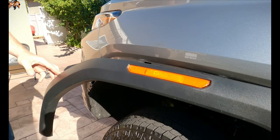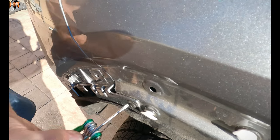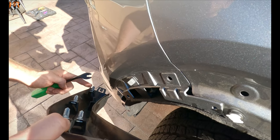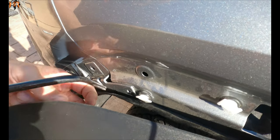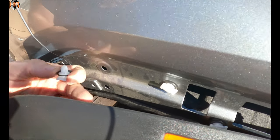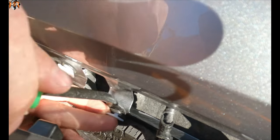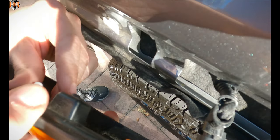We're going to go ahead and remove — there's one more Torx bolt here and that's going to separate the fender from the front portion of the grille. The fender flare is held up on various clips, so we did lose a couple inside. We're going to go ahead and pry them out because when we are reinstalling it, it'll make it easier if they're inside the actual flare as opposed to the vehicle. So we're going to take them out and then reinsert them into those grooves.